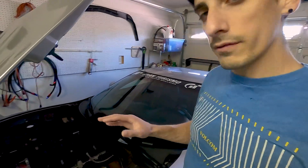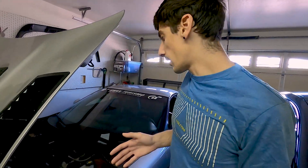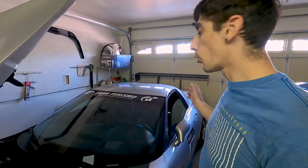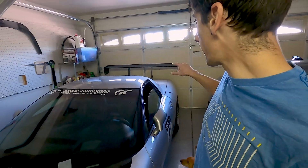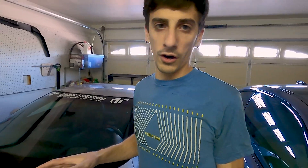The plan of attack today is we're going to start by taking the valve covers off, looking at the top end to see if there's anything apparent or loose. Then we'll probably move on to taking the cylinder heads off. The other reason I'm taking the cylinder heads off is on cold start I have some white smoke coming out of the driver's side bank, and this car does drink quite a bit of coolant and does overheat. So I'm thinking I have a head gasket issue or warped head on the driver's side.